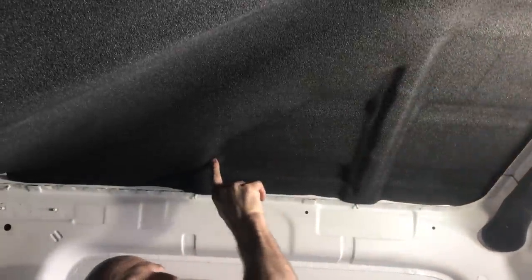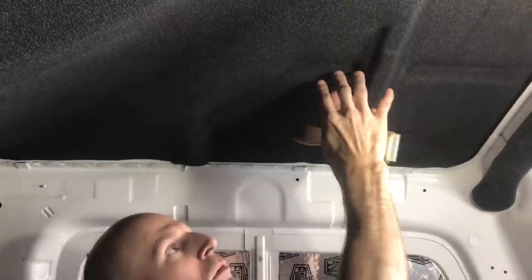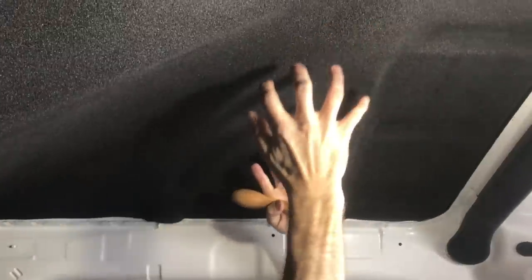So as you can see, we're stuck down through here where we've peeled the plastic out. What I'm going to do is slowly keep rolling out and then move across. So it means the material's falling into all these shapes, and effectively it's getting shorter this way. So we'll follow these channels. Important that same thing with this way. We're chasing it here first and in all those areas. And then we're chasing it over the top, so it's effectively shrinking there. This way you're not going to have any shrink back, you're not stretching it.